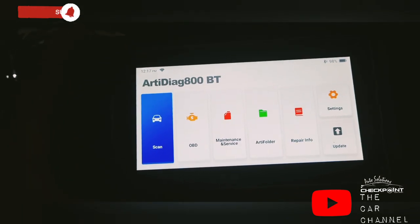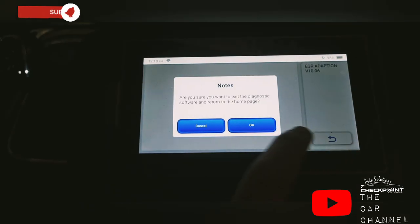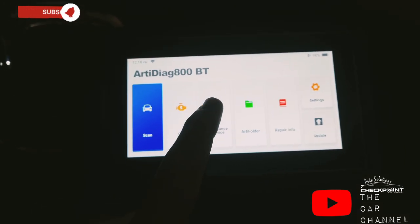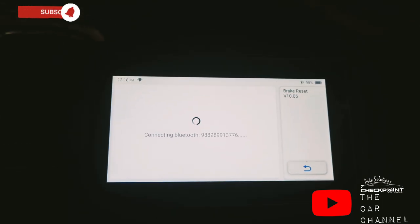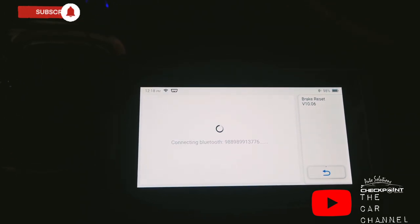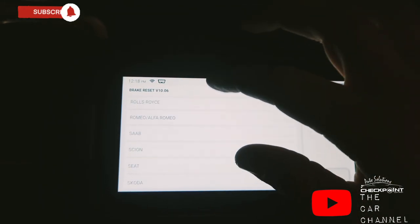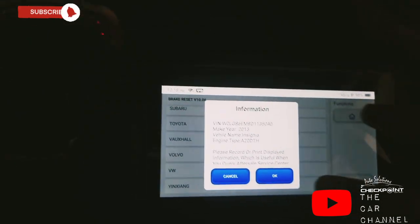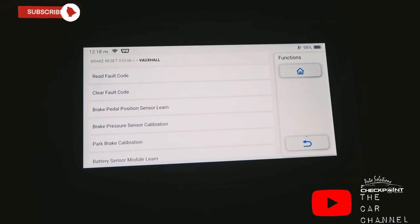Okay, in order to do this here on the Topdon, you need to go into the maintenance and service mode. You need to go for the brakes. I'm turning the key around so that we've got communication. Okay, scroll down. Vauxhall, ignition on. Okay, parking brake calibration. So this is the one we want.